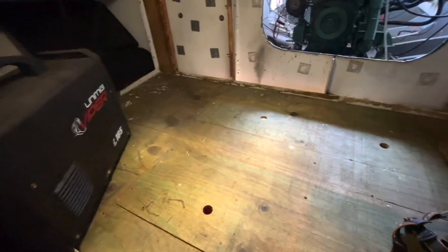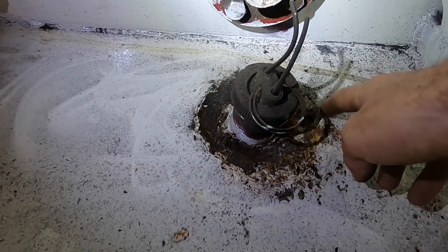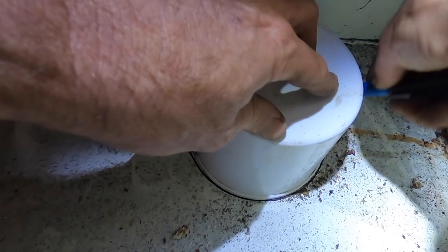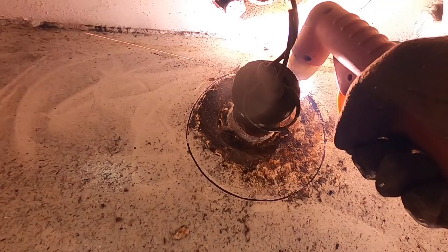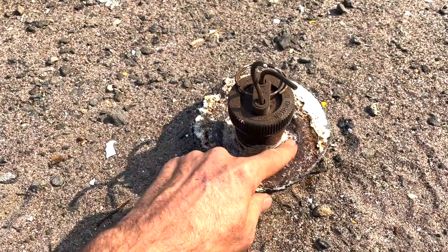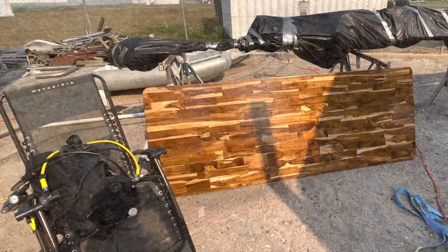Next I'm going to cut out the old paddle wheel that's below the bed here. You can see it's quite crusty and rusty around it, so rather than trying to do anything about that, I'm just going to cut it right out, put some new steel in, paint it all up — that's just one less place that could possibly go wrong down the track. I'm going to replace this with just a plain bit of new 4mm steel. It was always just cut wires so it doesn't go anywhere — glad that's gone finally.